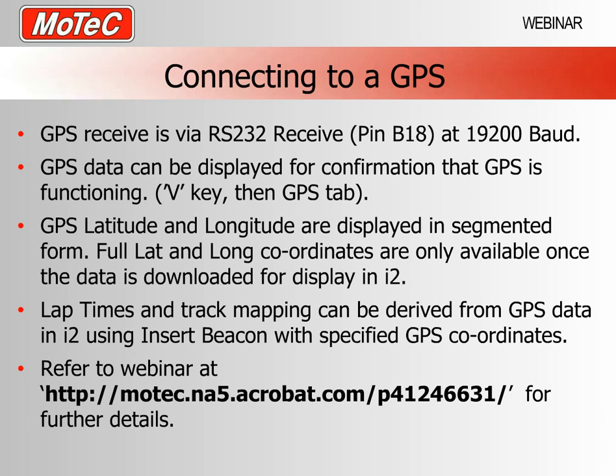The other thing we would most frequently use is a GPS. The great benefit of our integrated system is that you can log GPS data into your ECU and then use our I2 analysis program to do very sophisticated analysis including track mapping and lap timing. Our current system allows you to set the start/finish line at a race track as a GPS coordinate, and then the I2 program will automatically generate lap times based on that information. There is a dedicated webinar on this topic by Jamie Augustine if you wish to go through that in detail.